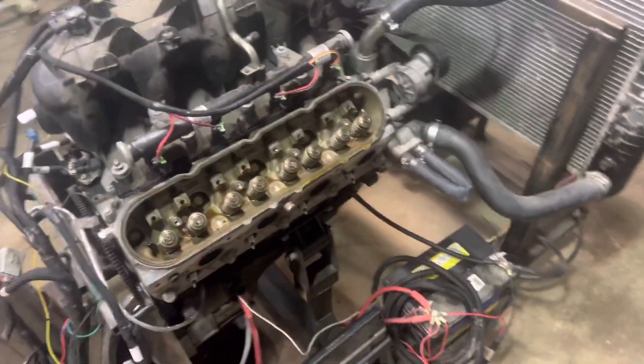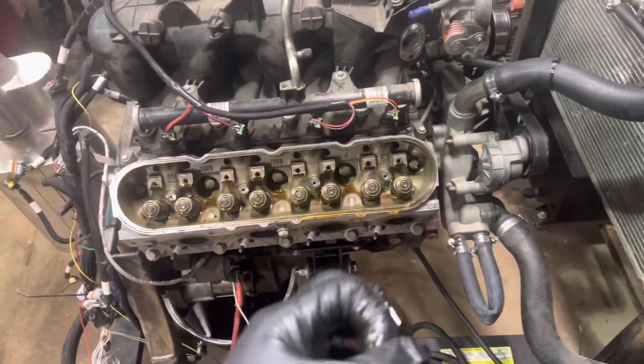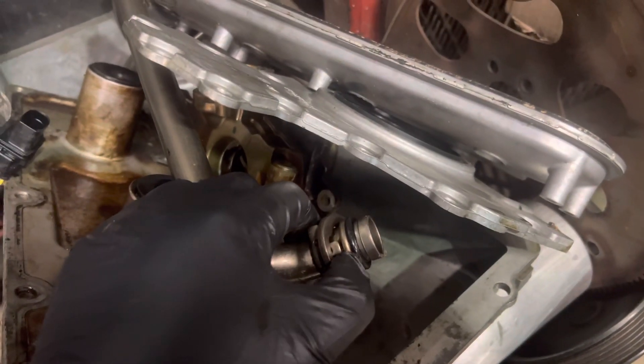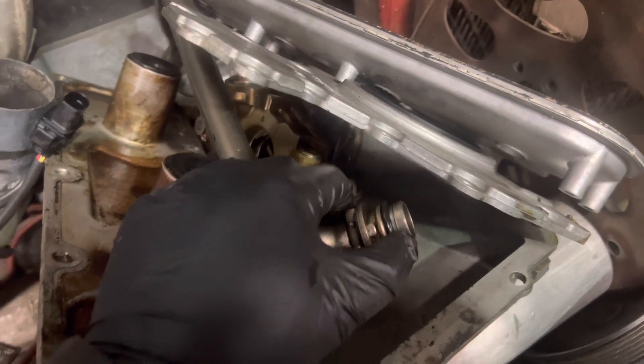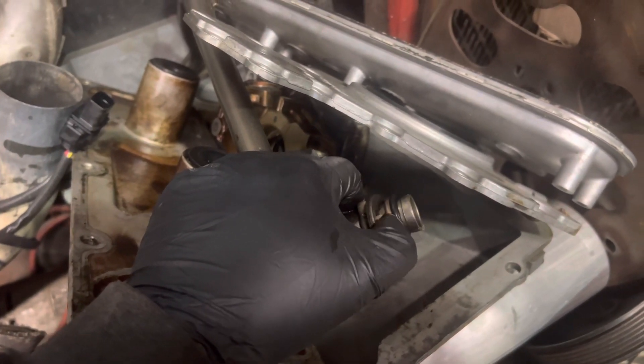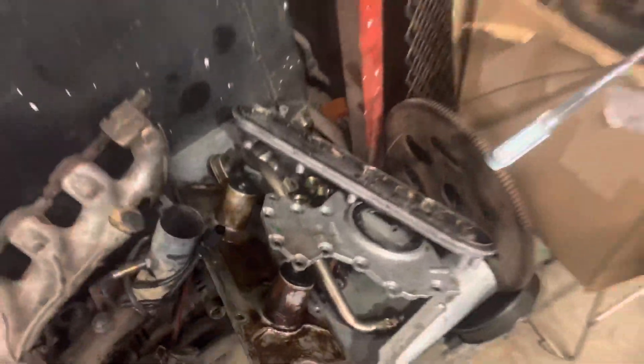But these things fail — not the oil pump itself, but the O-ring that is on the pickup tube. When this goes flat, it starts to bypass air into the pump. And it just kind of starts out, and over time it wears out and fails.